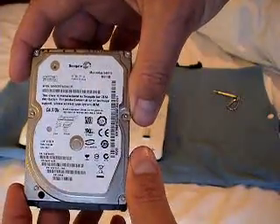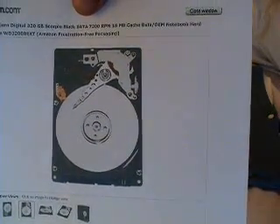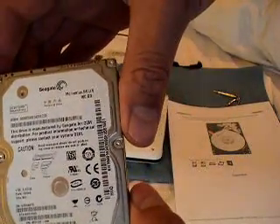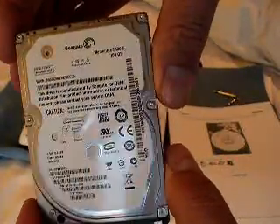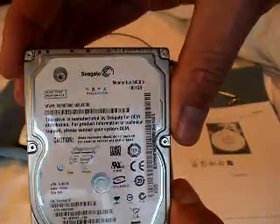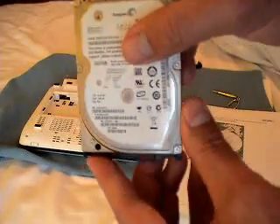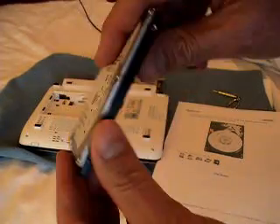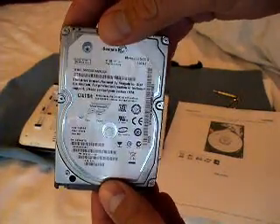This is what your hard drive actually looks like. The part that gets a little complicated when going to order it is you'll see pictures online, and this is actually of my hard drive that looked like this. But my hard drive looks nothing like that when I actually look at the part — it's actually got a case on it. So you want to not pay too much attention to those images. What you want to pay attention to is that you're buying a 2.5-inch hard drive. There are 3.5-inch drives out there, so you definitely want to make sure you get a 2.5 that's going to fit your netbook. Pay particular attention to the dimensions: it's basically 3.9 to 4 inches long, 0.4 to 0.5 of an inch thick, and 2.8 inches wide. That's the critical part. Hopefully this will help.